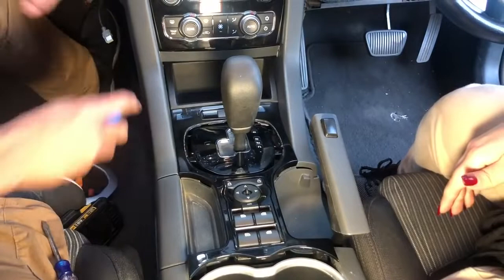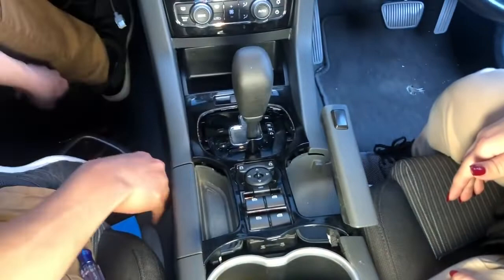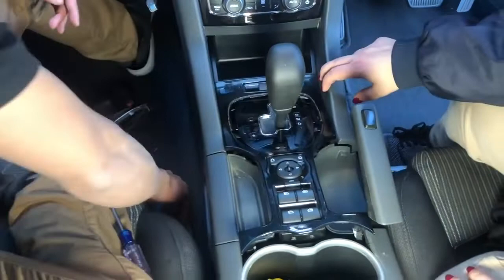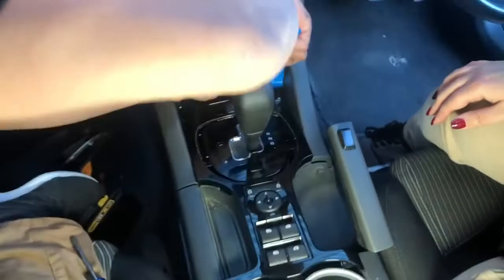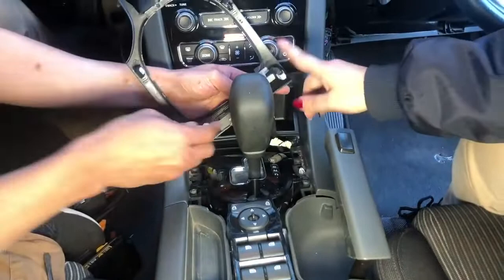A lot of these plastic trims are just clips — plastic clips. They come off easily but have a bit of a trick to them, so use the proper tools and pull them carefully. They don't break easily. That compartment just came off as well. You can hear the clips coming off — that's what it is. All the clips are in place, none are broken.